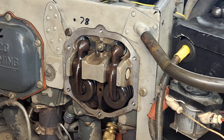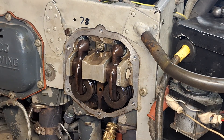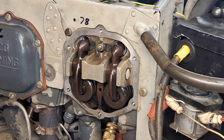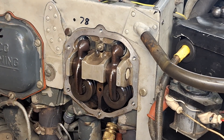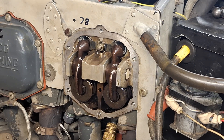This is a tool I made for doing the angle valve — once I put that on with a spacer in there, these holes are drilled on an angle so that you can push the valve down; it goes right beside the rocker. You only have to push one down, and there are two rocker shafts on the angle valve engines. Well, I hope you find this informative — leave me a message if you think so. Take it easy.